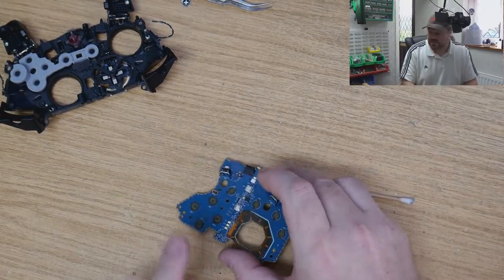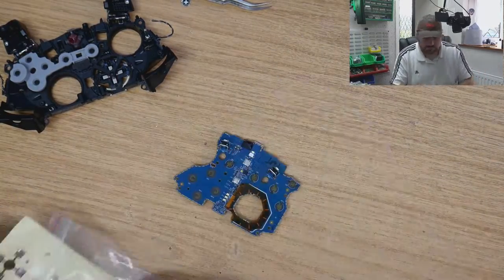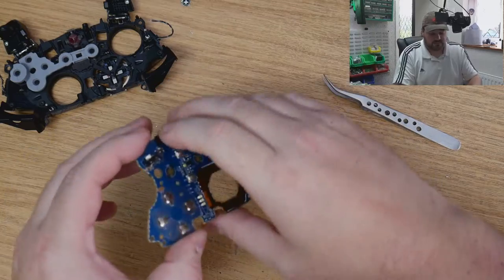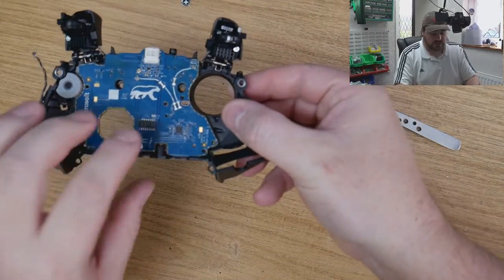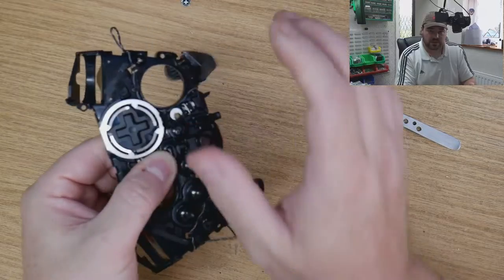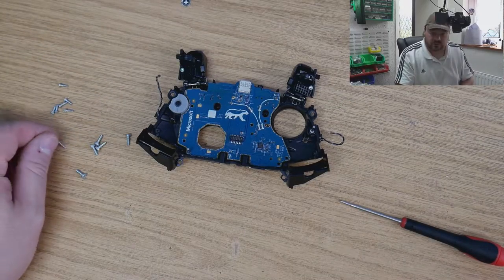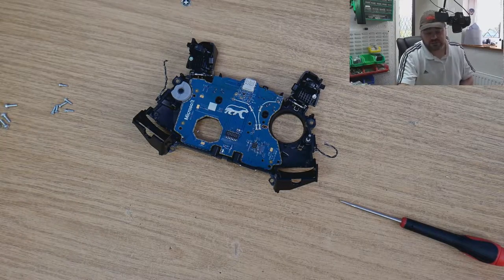Almost forgot the D-pad film. With these stickers I don't want to fully press it down because I might need to reposition it - just get that in there, put the board in, and just hold it with my fingers. The click sounds roughly similar in all four directions, so we know that dome sticker is correctly located. I've dug through a couple of donor controllers and we've got the correct set of screws and also a couple of magnets for the rear shell.